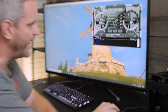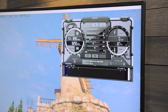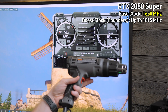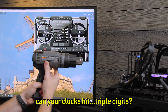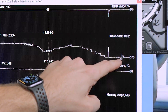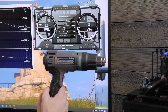Now watch — if I reduce this temp limit down to around 77, the fan has not ramped up because we locked it, but our temperature is still sitting at about 88C. If we had 70 set as our temperature limit, it would have done this behavior at 70C. I'm going to put it right around the middle. Now I'm blowing hot air on it with a heat gun — look at the clocks. We hit triple digits on temperature! That's your base clock — around 300 MHz. I don't think it can go any lower. That's absolute emergency mode: still getting 33 FPS in 4K.